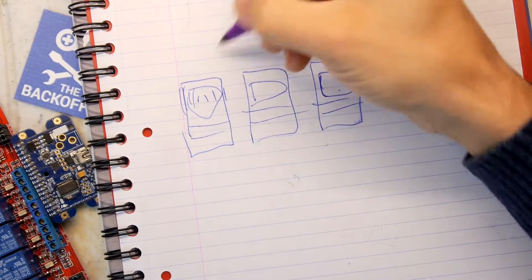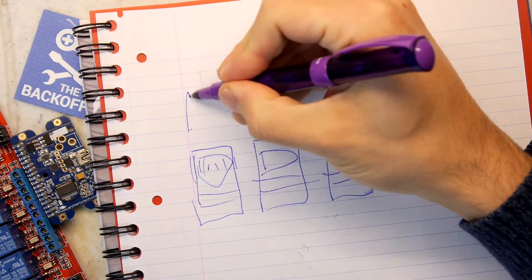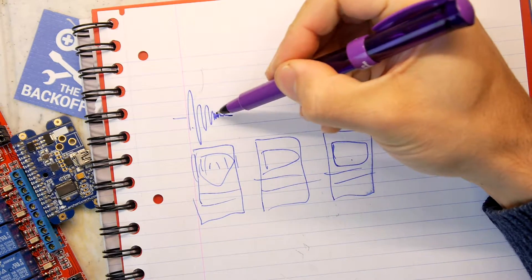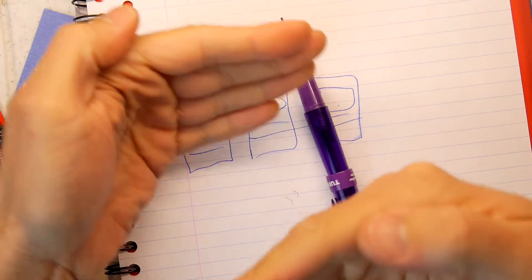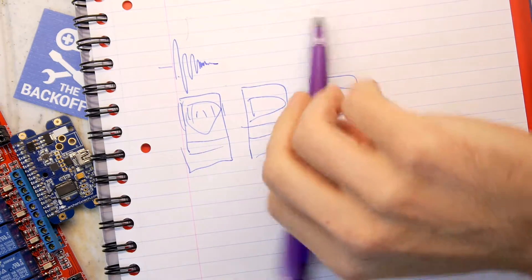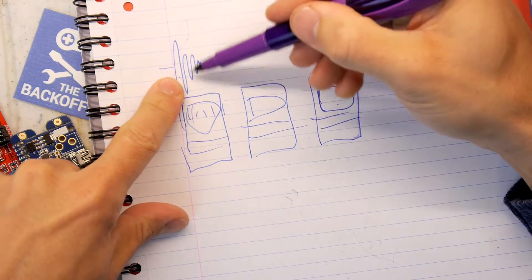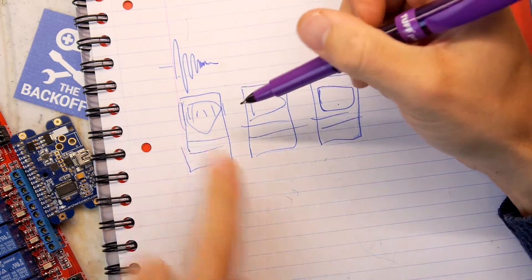What the degauss is: there's a magnet inside the screen and it fires a massive magnetic pulse, then makes it really tiny and turns it off. You get this big pulse, which actually moves the grills within the screen. The idea is to demagnetize it — so if there's any inclination on that metal gauze to north or south, the pulse cycles north, south, north, south — then nothing. So it should end up as nothing.